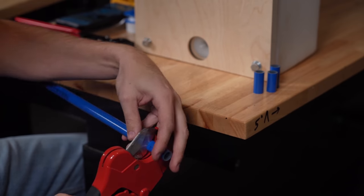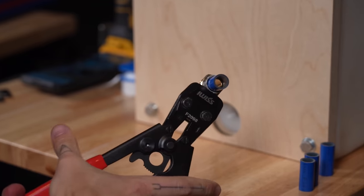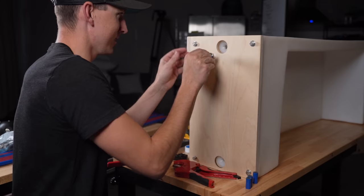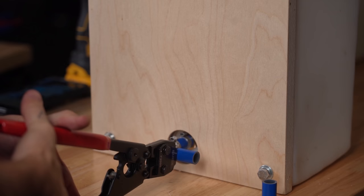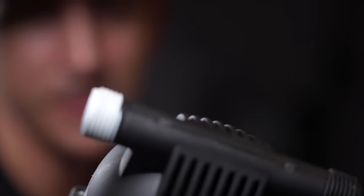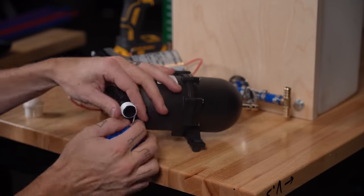Next up was plumbing. We used PEX tubing and crimp connectors for most of the plumbing for the system. All threads got Teflon tape, and we used tons of T's and L's to get the water where it needed to go. We attached the water pump and accumulator to the pipe coming from the lower water output of the tank and attached that to the frame.